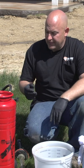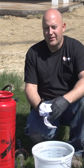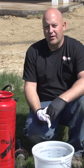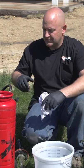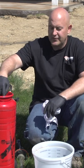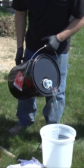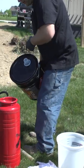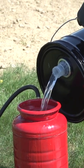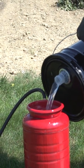This seems simple, but after we dump this in here, just taking a rag with a little bit of xylene on it and cleaning this is going to do a world of good. When you dump this in, inevitably it's going to get on this rim a little bit — it's going to want to slosh. You have so much more control if you tip it and do it backward like this. You're going to get sealer on that seal, and as that sealer builds up on there, that's where you have your problem.